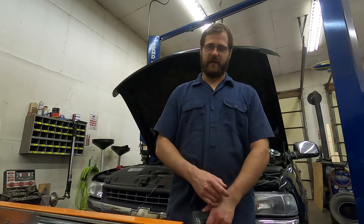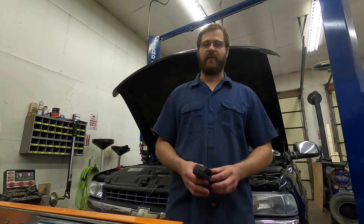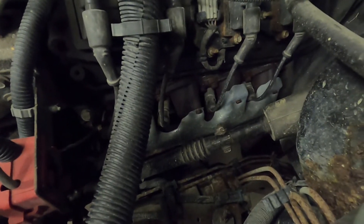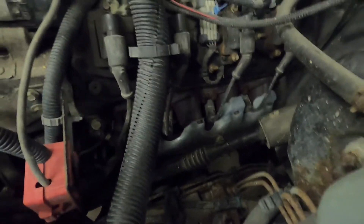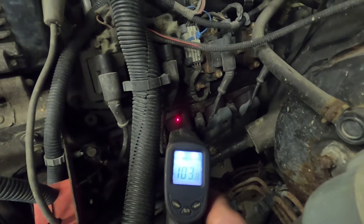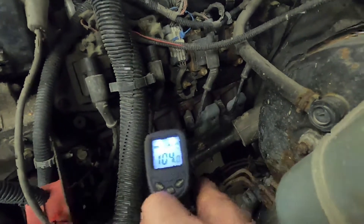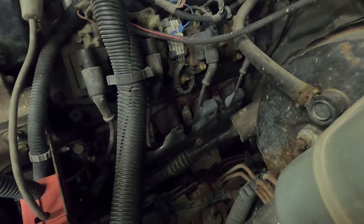You can use this on a carbureted vehicle, you can use this on an OBD1 vehicle. I went a little bit old school, and that is a thermometer — an infrared thermometer. What I did is I started the truck up. It's cooled off a little bit now, but what you can see if I move this stuff out of the way is you've got eight individual exhaust runners, four on each side. So I started it up and used my infrared heat gun — you should be able to see a little laser — and I temp-checked all eight of these exhaust manifold ports as it was running.